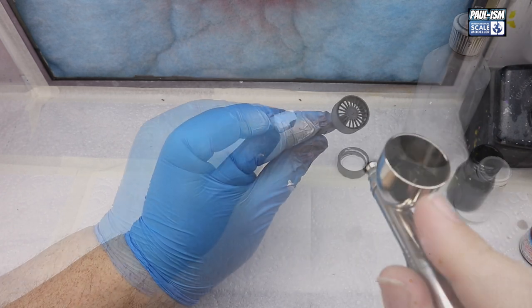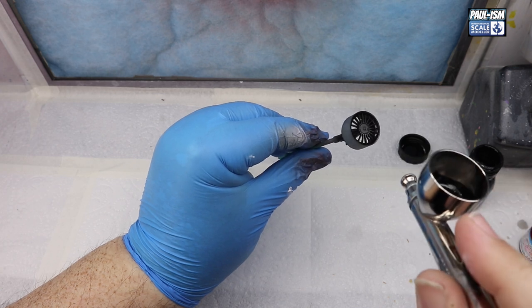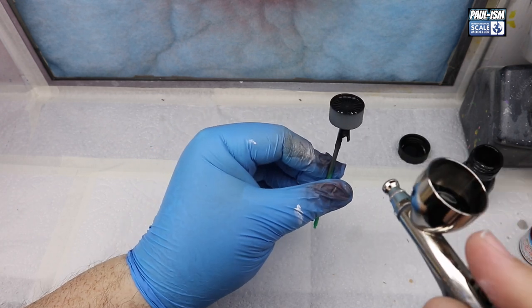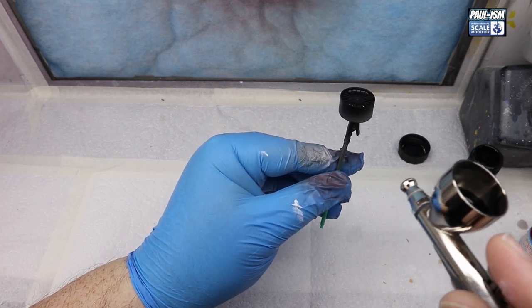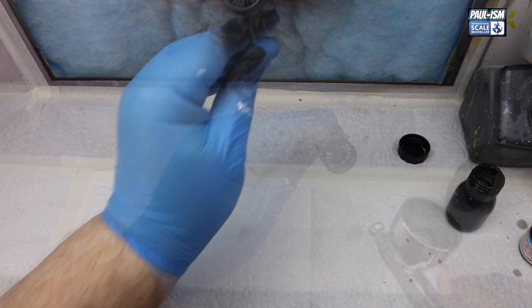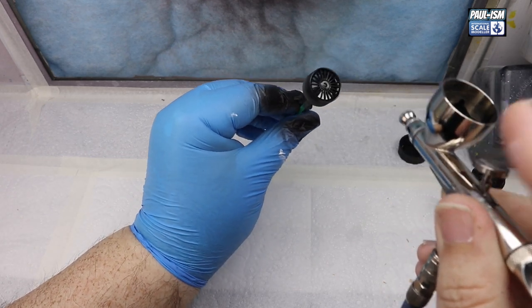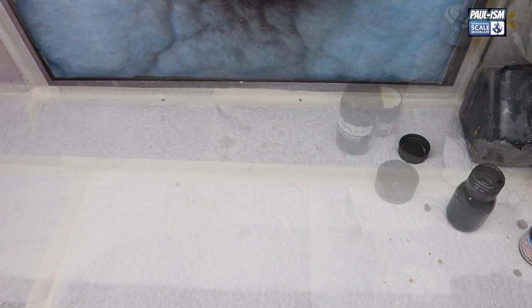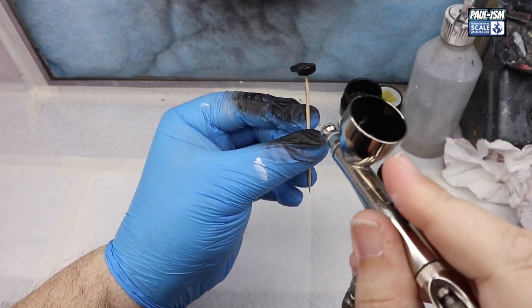And then with our wheels, we're going to use GX2 gloss black and get a nice gloss black base down. Using probably 3-4 coats of this stuff, leading up to a wettish coat at the end to get a nice gloss black finish. Like so. Don't go mad, just keep building it up slowly, get all the angles and recesses. Mist surface of black on our brake disc for now as well.